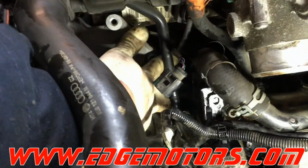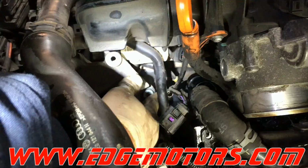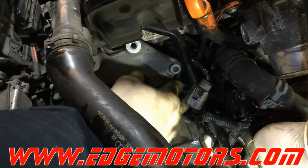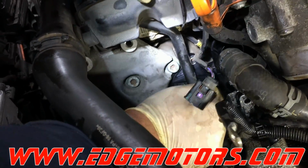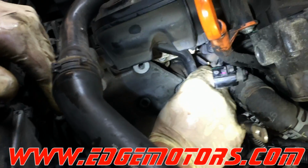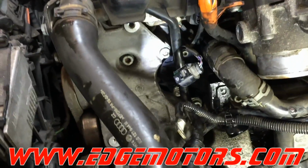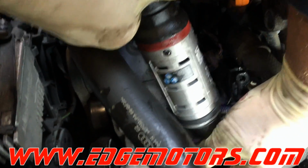When putting it in, do not just tighten it down with the bolts. Press on it gently and twist it back and forth. Make sure it's sitting flush against the block before you put the bolts in. Now align the bolts and the bolt holes. Make sure it's still sitting flush. Now you could tighten the bolts.